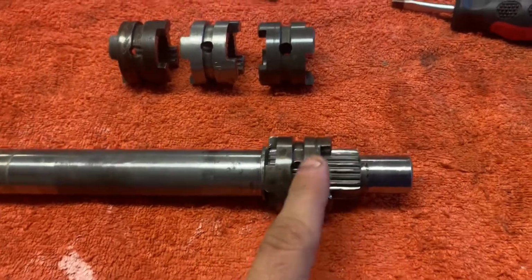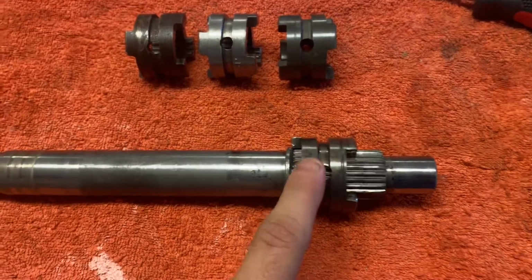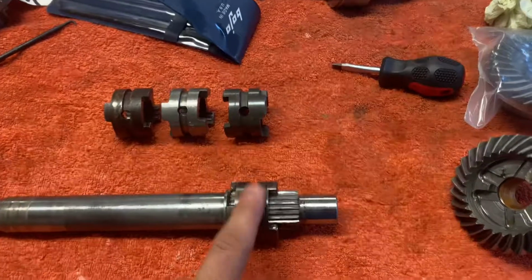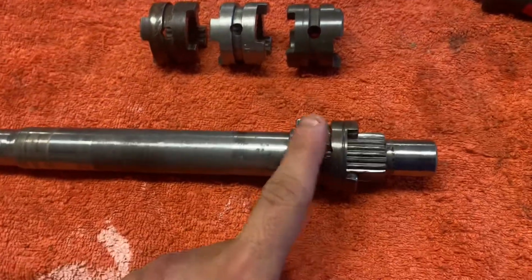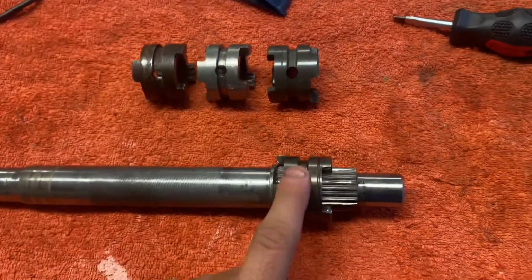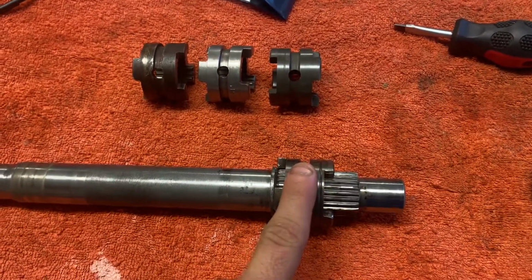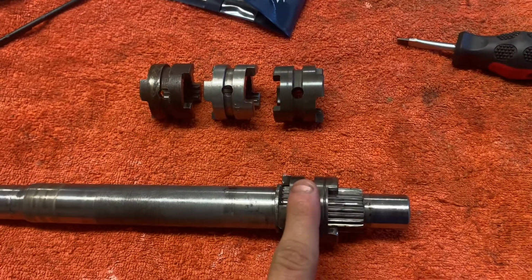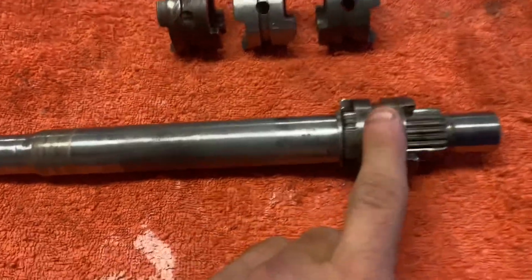But what I realised, that perhaps I didn't mention in the original post, was that the clutch dog was an aftermarket clutch dog. And so to go back a few steps here, the reason I've got this apart again a few years later is I do have some problems with the dog slipping out of gear. And it's been some years now. I had this motor working, but occasionally I would hear this kind of boom sound when it was slipping out of gear. And it got worse and eventually got to the point now where it just doesn't go really in forwards or reverse without slipping out of gear.